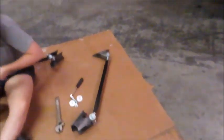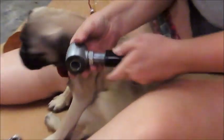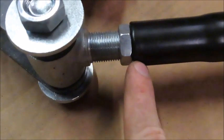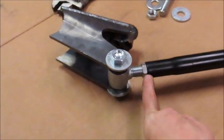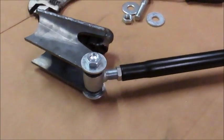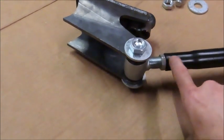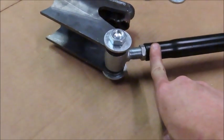Right now Hannah is putting on these brackets that will weld onto the truck, and she's checking the length between right here and right here. There's a total of 39 threads on this. You want these to be adjustable as possible in case your rear end is not 100% in its place. One of these nuts is four threads tall, so what we're doing is taking this all the way up and then counting 16 threads till it meets this — that gives us about half minus one thread. That way if we need to adjust it forward or back, we can.